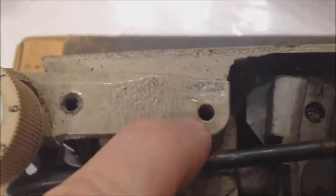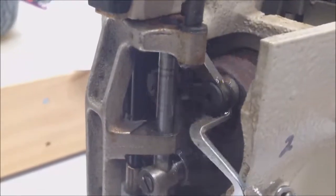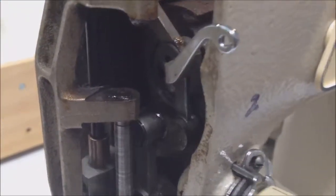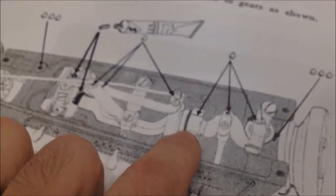You also need to lubricate on top because this also moves. You need to lubricate in this hole here because that lubricates this main bearing. You need to lubricate everything in the front — that includes the up and down motion here on this shaft. On both places, you need to lubricate this shaft here where it interfaces, here and up here as a guide. Anything that rotates up here needs a shot of oil. All these little arms, which are much happier now with oil, need to have a drop of lubrication put on them. The manual says if you use this every day, you need to lubricate it every day. So it's one of those hardcore really get-to-it machines. Just about everything on the front that moves — the chart shows the oil points. Download the manual for your specific one. There's also a lubrication point I probably missed on the bobbin driver here — this is a little stiff, so I bet it needs oil too.